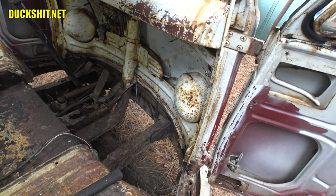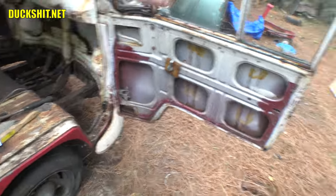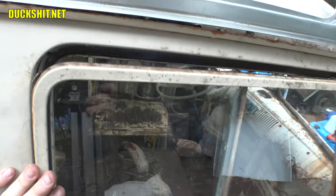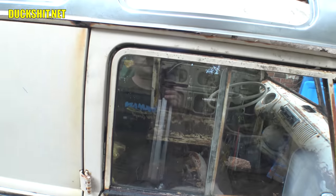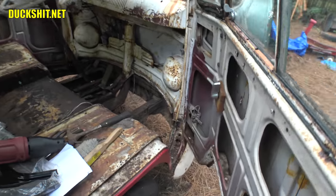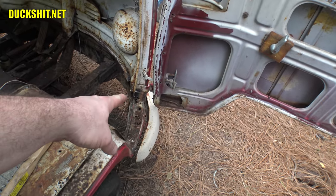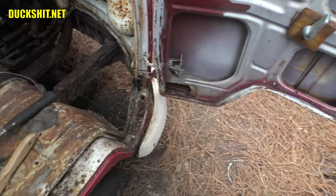This is a critical part for door alignment, as this door does sag a little bit. The bottom hinge has a little bit of play in it, which causes the door not to close straight — you can actually have a finger's gap in there, so you've got to lift up the door a little bit to get it to close. The sag is dramatic enough that it needs to be fixed. I can see a big hole right there on the bottom — that's probably why it flexes so much. I've got the piece to fix that too.